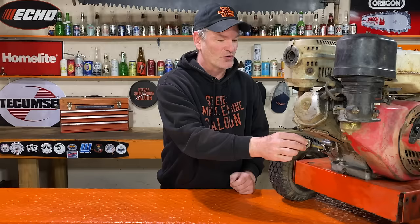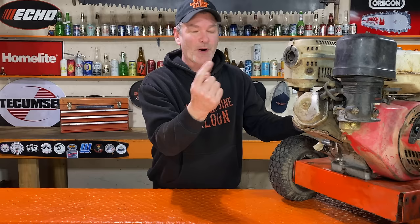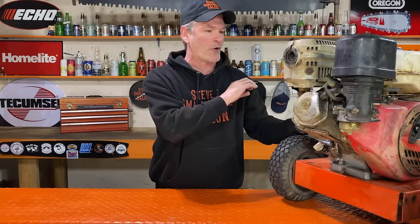Check this out. I turned that over — I took the spark plug out and looked down the hole. I turned that engine over back and forth and the piston isn't even moving. The connecting rod, the con rod, is blown right out of this engine and it's no longer worth fixing — not even close to being cost effective. All because the person trusted the dipstick.